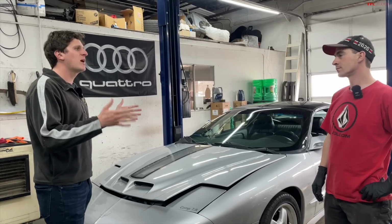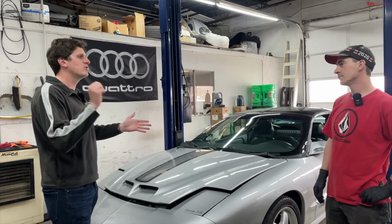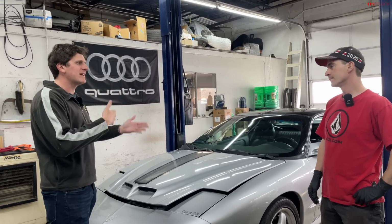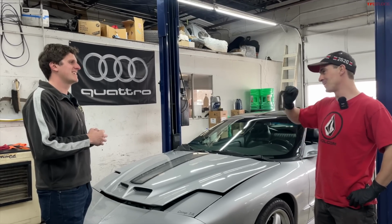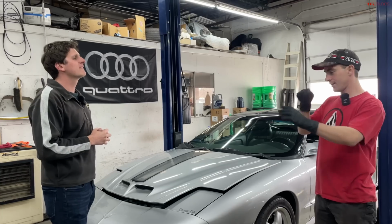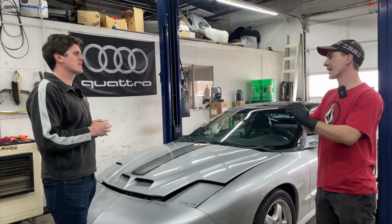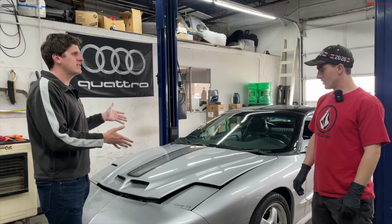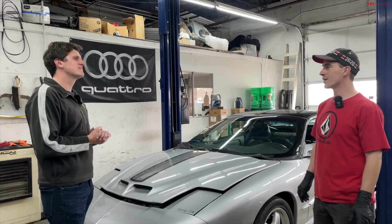Now, some things I want to tell you about. The starter, once every like 10 tries, doesn't do anything. It just goes zzz. So is that indicative of a bad starter? Yeah. It did it to me when I went to pull it in. It wouldn't start. I had to cycle it a few times, and then it kicked the starter in and worked. So is that an issue with the solenoid or something? The solenoid, yeah, the part that shoots out to actually engage the starter, usually that goes bad. The contacts internally go bad. Have you replaced a starter on a 350 Chevy? Usually it's basic, simple, 2 bolts from the bottom, not as tight as some of the new stuff I work on. Cool.